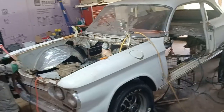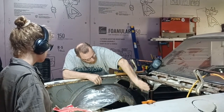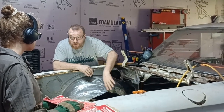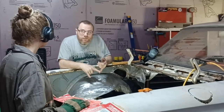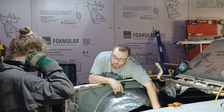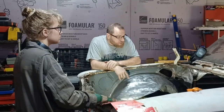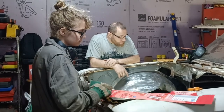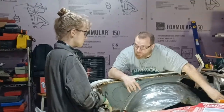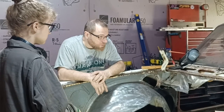I think once we get above to this point, we'll probably end up coming across here just straight down or at a slight tangent, and then we'll build in from the floor pans to whatever we built here because we don't have a heater box yet and we've got no idea how much room we need for that. But we do know the exhaust is going to be going through here — we're going to need some of that room where the floor pan was pulled back for the exhaust on this side. Things might start getting a little sticky. So we're going to be tapering and then end up building something almost straight back and then over and back out.